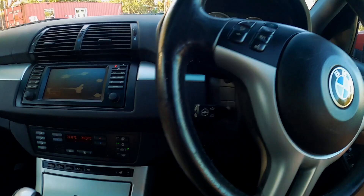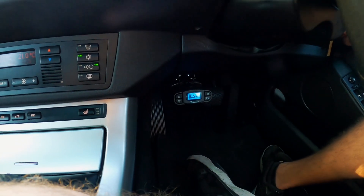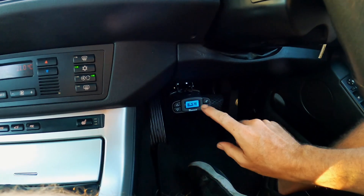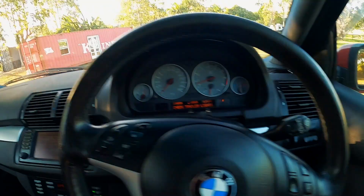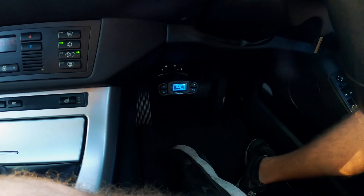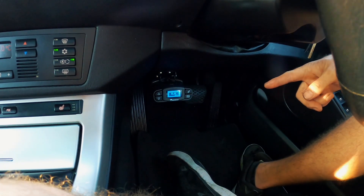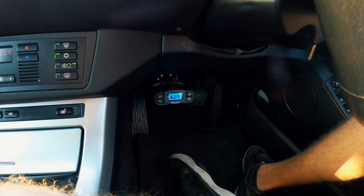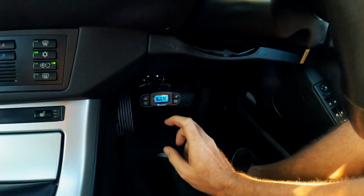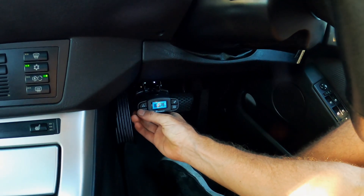So I'm not sure if we've got some sort of shorting, or because they're LEDs, it's running power into the brake light signal. I'm really not sure. If I turn the headlights off, that'll drop down. Headlights on — takes a few seconds — and it builds up voltage. Turn the headlights off and it drops down. So whenever you've got the headlights on, the brakes are going to be dragging. That's a bit of a bad design.